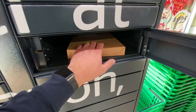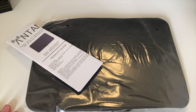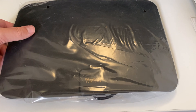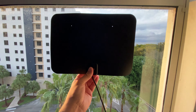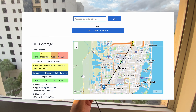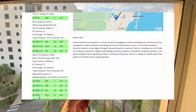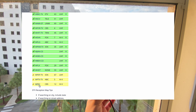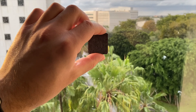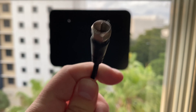For the purposes of this video, I bought a mudflap-looking antenna on Amazon and tested it out. A TV antenna like this will work great for most people where signals are strong. Find a window where you can attach the antenna. For optimal results, go to the DTV Reception Maps website from the FCC to find the locations of your local broadcast stations and aim the antenna towards those stations. I'm currently on the sixth floor, which does help, but this can be done on any level.